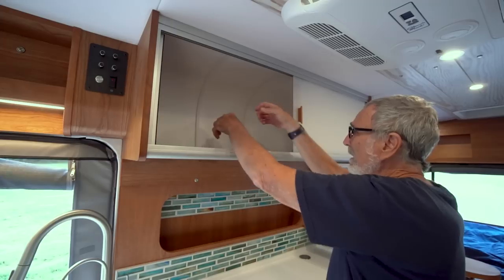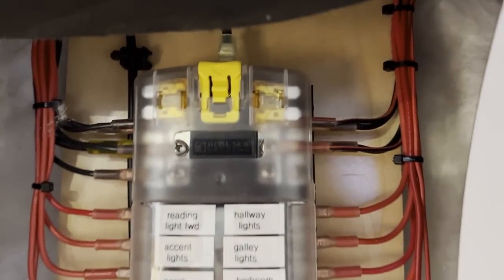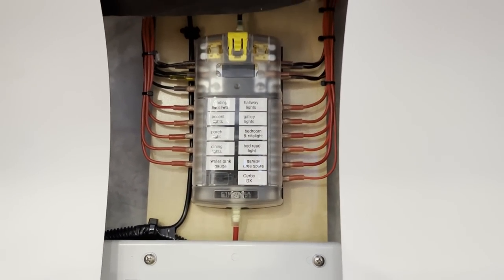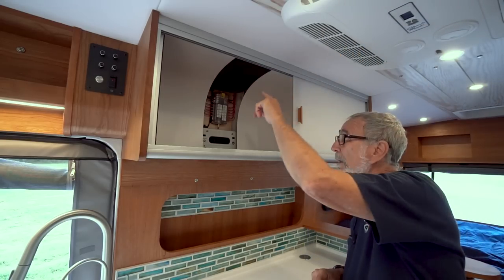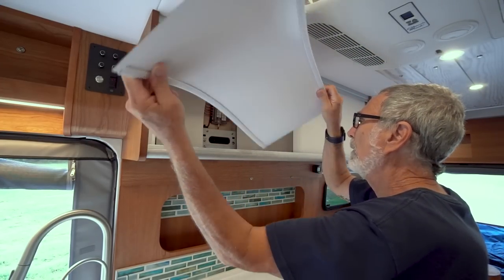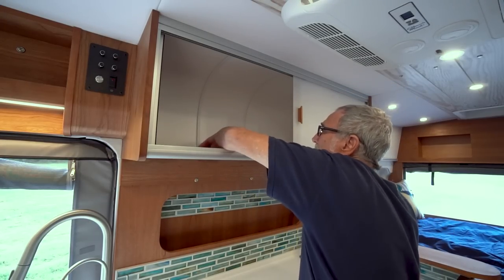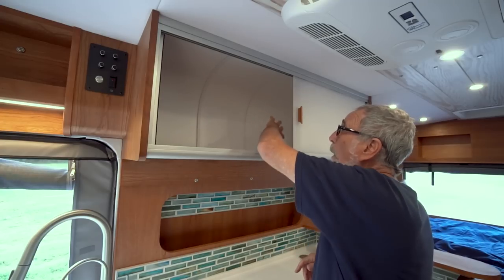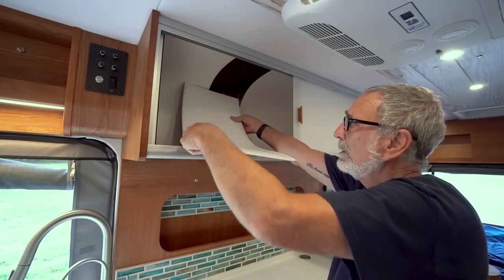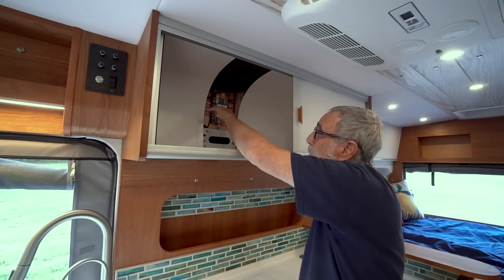In this cabinet here, we have a panel that comes out and we have a sub-panel — this is where I put all my lighting sub-panel. Rather than take all that extra wiring over to the main panel, I run a trunk line over and everything's right there. When you need to get to it, it's very simple — you just pull this panel out. It fits in the 80-20 channel, so all you do when you're done is push it back. All the wall panels in the van are removable. That way, if we need to in the future, if Stephanie says she'd like us to run a line, we can do it — all these panels come out.